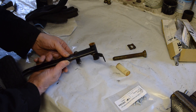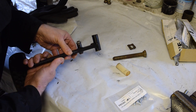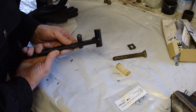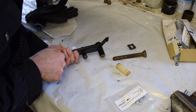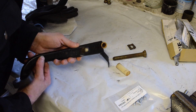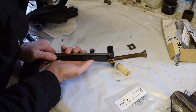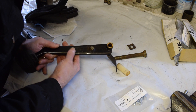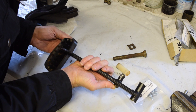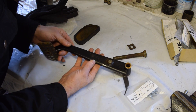The pedal's out. The piece I need to get out is here - I think it's rusted in place, unless I'm mistaken and it's supposed to be there. My expectation was that I pull the pin out and the whole thing comes out, but looking at it now it looks pretty stuck in there. I'm going to get it on some wood blocks and try and tap it out, maybe give it a little warm up. While the pedal's out, I think I'll send it away to get powder coated - there's a little bit of rust on the pedal itself, so it might as well join the bunch.